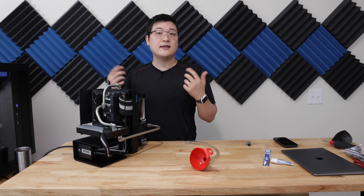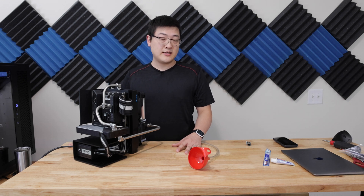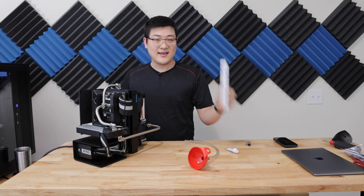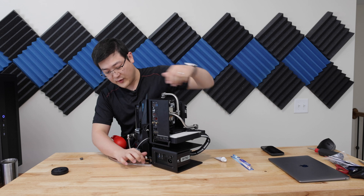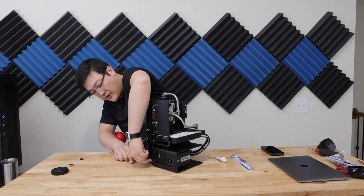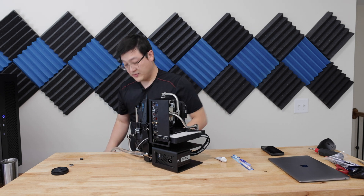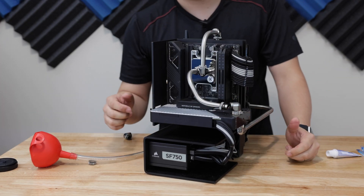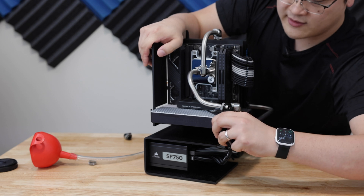That's why the entire block seems to be exhibiting this issue. I'm going to be draining this and then trying to disassemble, and we'll see if we can clean it up with the method that Jay suggested — using toothpaste and a toothbrush. The way I designed this loop was pretty forward thinking, because I have a very low point drain right here at the very bottom of this radiator. All I need to do is open up this valve and I can start draining this entire loop. Disassembling this water block isn't actually all that difficult — it's just one connection here, one connection here, and then the power cord, and then the GPU just comes right out.